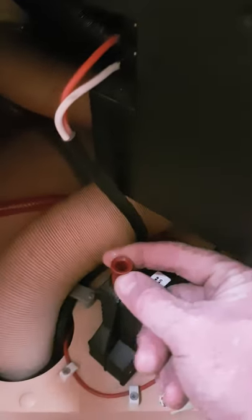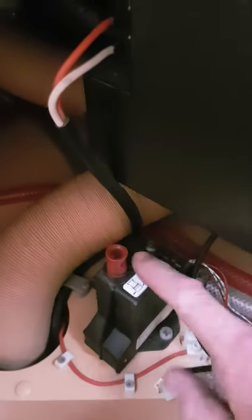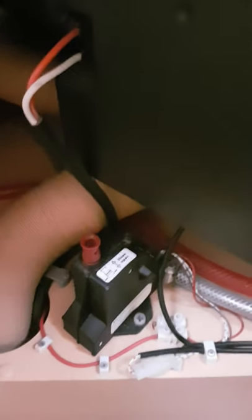Now we're looking at the frost valve here. At the moment it's up, meaning it's closed. At two degrees it'll drop down by itself and drain all the water out of the water heater. If you also open all your taps it'll release all the water from the taps down through this valve out onto the street. At two degrees if that drops, you're going to lose water pressure. The way you correct that is come in and pull it back up. If it is genuinely zero degrees in the van that will not stay up — the only way to get it to stay up is to switch on your heating, which sends a little voltage down these wires to hold it. So there's no need for pegs or cable ties — just switch on your heating and it'll keep that up for you.